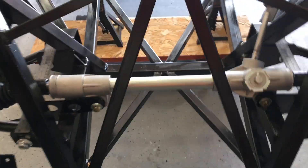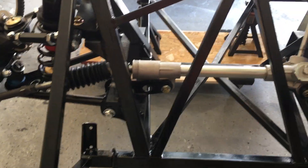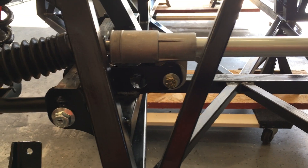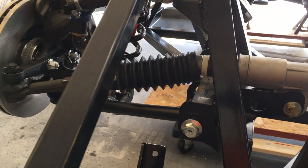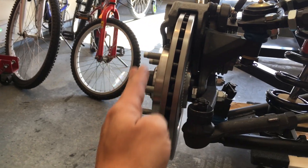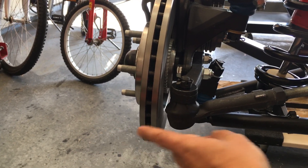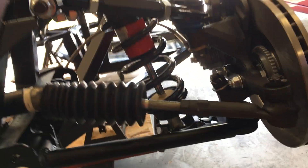Basically, once you've got your suspension upper and lower arms in, you've got the steering rack. Mounting the steering rack is pretty straightforward — that's a no-brainer. The problem comes when you start trying to get the angle of the wheels correct. The tie rods for me were way out here, so the car would be pigeon-toed outward. It would look absolutely terrible and it would not function.